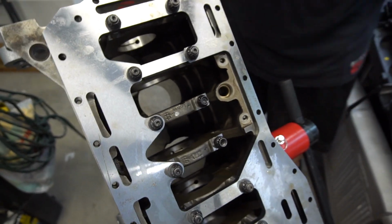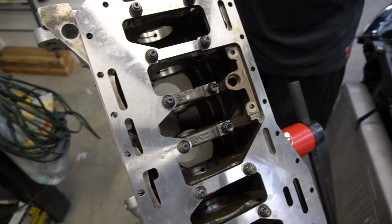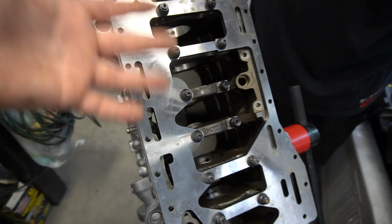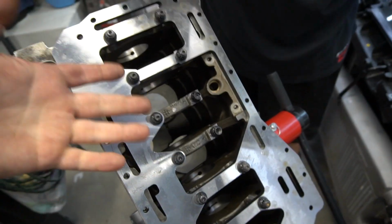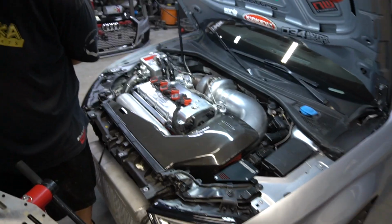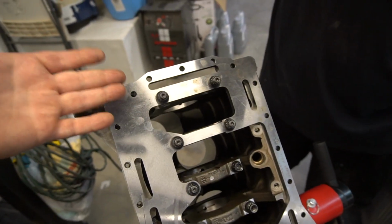Never. And to be honest with you, I made 750, 754 wheel on the 2.8 VR6. Could probably make a little bit more, but I didn't design it with the higher end tolerance. We didn't O-ring the block. We didn't do anything for higher cylinder pressures or even nitrous. And we figured if we're going to be shooting for power, we're going to be racing. The RS3, I mainly got it to go down the quarter mile, half mile, and have some fun. We figured, what the hell? And it was a small expense.